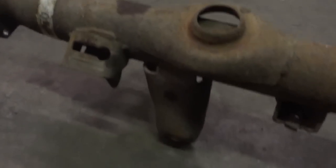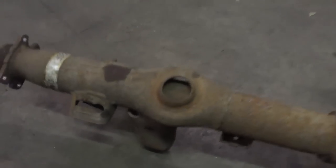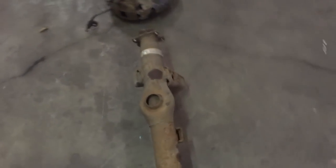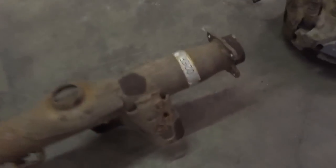On the G-body the shocks are on the back like a Fox body, but on this diff they're at the front. So I'm just going to chop out that section so I can use the factory sway bar, and then I'll probably just weld the shock mount onto the back here, and the shock will go right there with a stud.